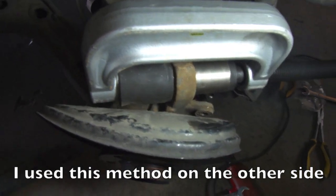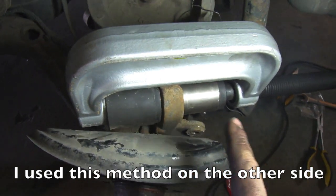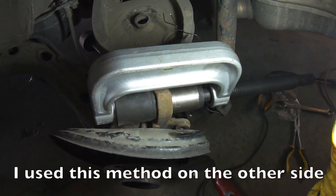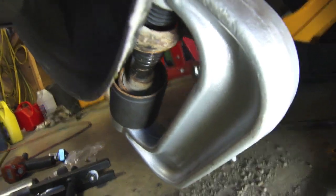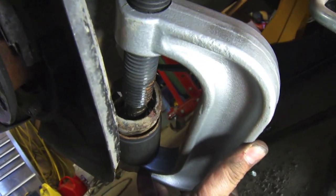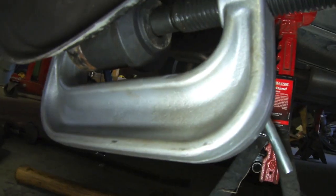That's my setup — it's pushing out the upper ball joint. I bent the dust cover back, put an impact on it, and it's already pushing through. For the bottom one it just wouldn't come; I used the ball joint press and it forced it out. These bushings in the rear are taking a long time — they're heavily corroded. I've got one to put in there and one up there.